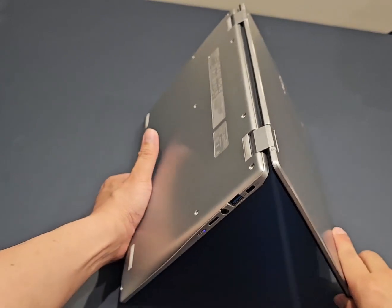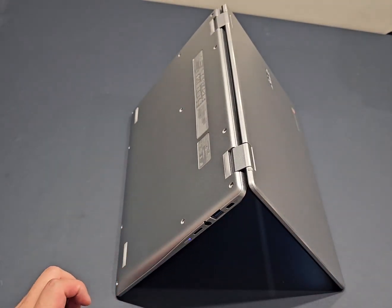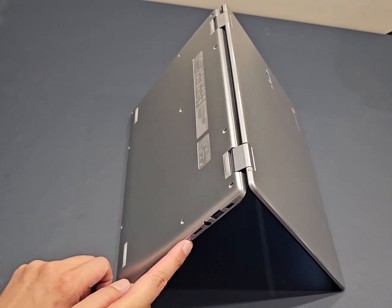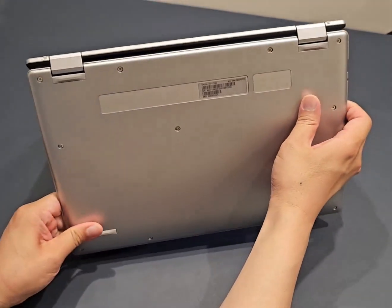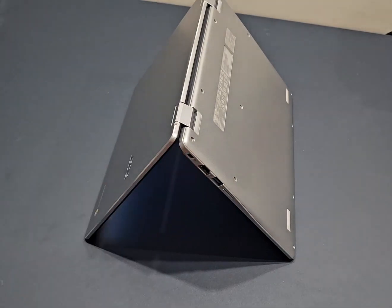Because it's a convertible, a lot of the buttons are on the sides — the power button on one side and the volume controls on the other. In terms of ports this machine is pretty generous: a full-function USB Type-C port for power, video, and data (no Thunderbolt though), a USB 3 Type-A port, a combo headphone/microphone jack, and a micro SD slot. Because this uses eMMC storage, we can't fully utilize the USB 3 5Gbps data rates — I tested a 10GB file transfer using an SSD and was only getting around 200MB/s. On the other side there's a lock port, a full-size HDMI, and another USB Type-A port.